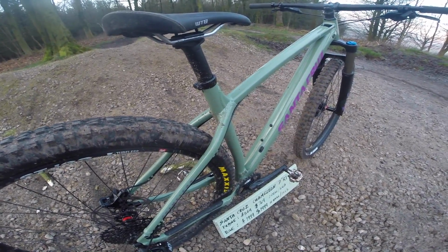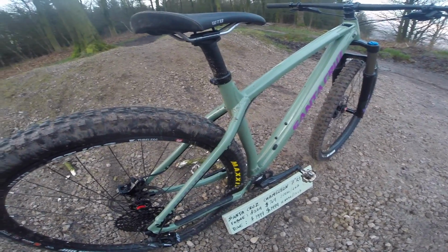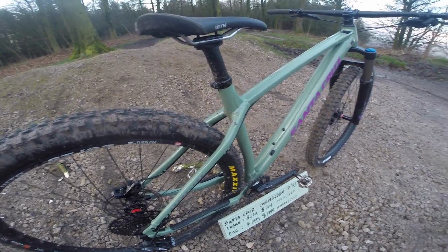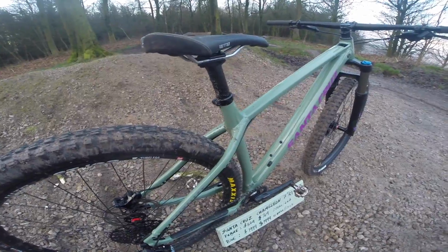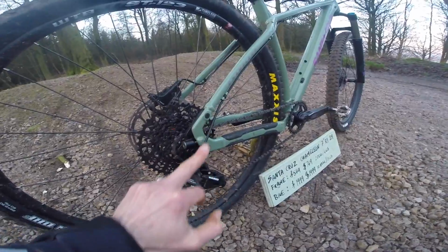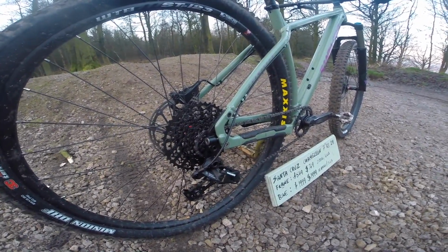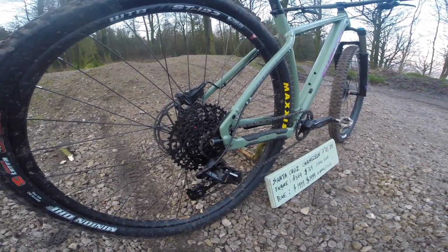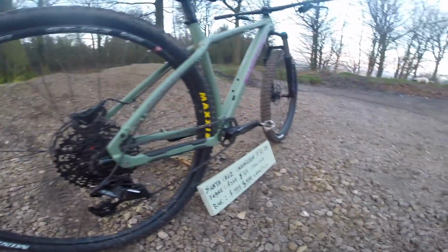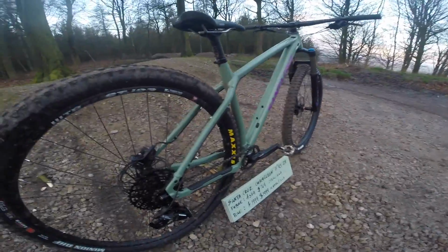So there is a lot of room here. As you can see, this 2.3 29er looks skinny. It'll go to a 2.5 in 29 or it'll go to 3" plus with the 27.5 wheel, no problem. But to make sure that doesn't kick the geometry out of kilter, you've got these, not sliding dropouts, they're swinging dropouts. You loosen that and the whole dropout pivots backwards and forwards. It comes with two different dropouts, the 29er and the 27.5, which is a different height by 8mm, and that retains the same geometry. It's a 315mm bottom bracket height and it's a roughly 67-degree head angle up front.